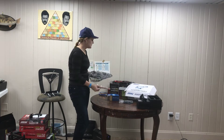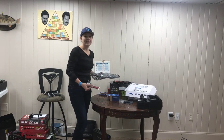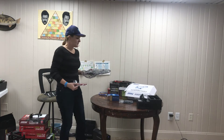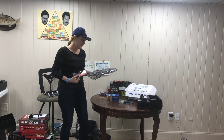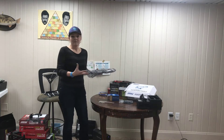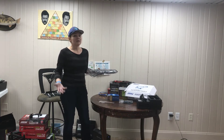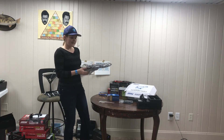So I'm going to do just a minimal setup — just one GPU — and install it and see if I can get it working. The challenge is I don't have a monitor; Alan actually took the monitor with him to go install. So I'm going to see if I can use the easy debug LEDs, which is a feature on the Z270s, just to see if everything's up and running and looks correct. Of course, we'll still need the monitor to really get into the UEFI configurations, but at least we'll be able to know that the memory is good and that it'll work.